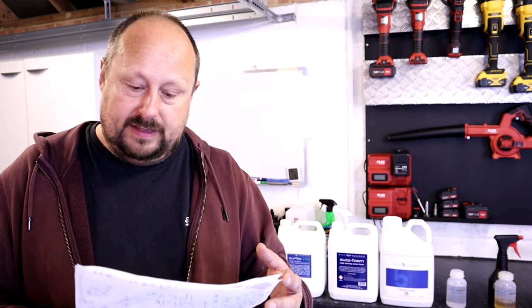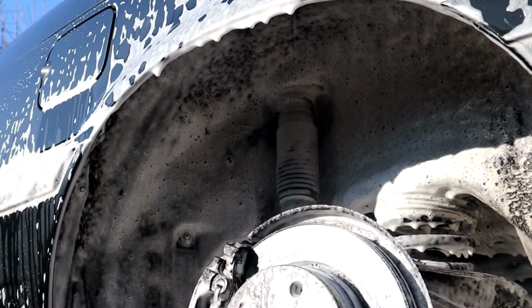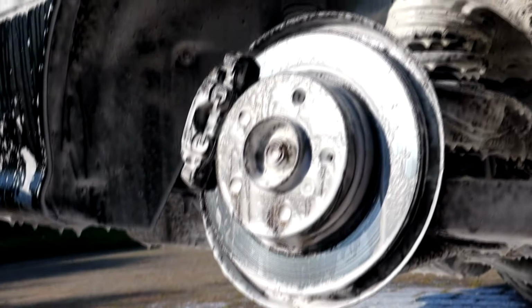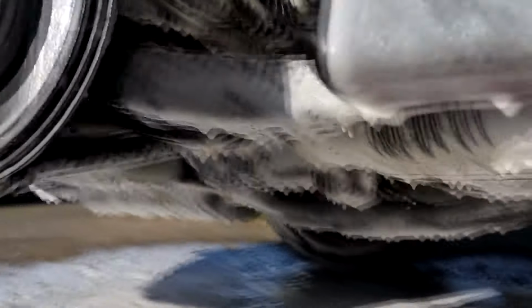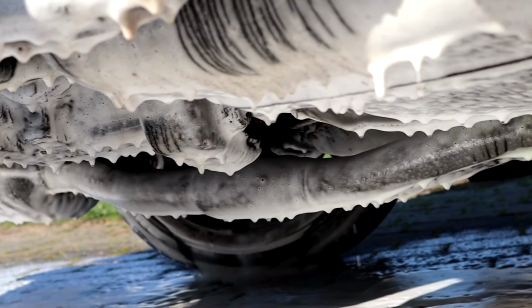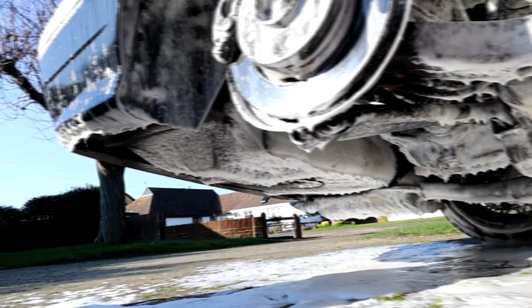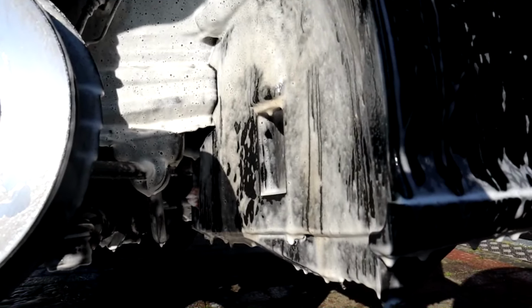Now, on to the other one. Touchless, the new pre-wash that they've released. Touchless is built around a sugar-based surfactant that is exceptionally mild. It contains no solvent and also has a very powerful static breaking ability. This releases the bonds that hold the particulate road films to the vehicle and hold the dirt together. So it breaks down the little charge of dirt, and dirt does have a charge.